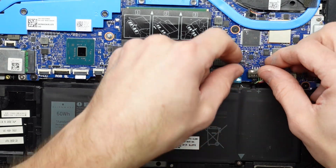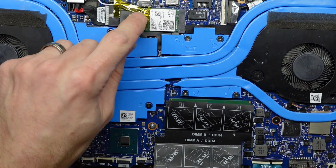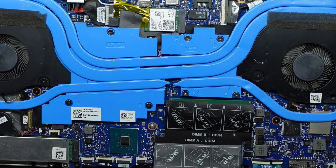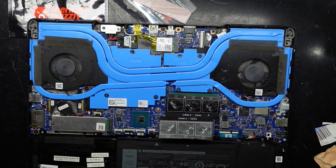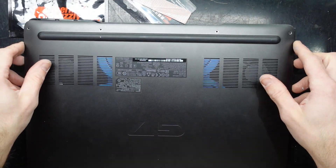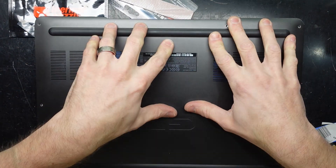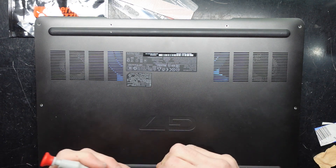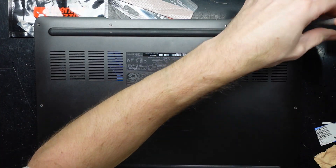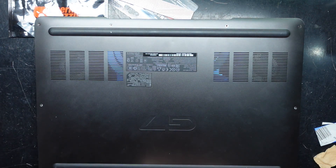I just need to connect the battery back up — it should be a matter of pushing it down over the top. The Wi-Fi antenna still feels like it's on. Now the back cover goes back on — it rotated during it, but just push down lightly and click it together. Put all those screws back in and you should be right to power up your machine. If you've upgraded the NVMe, reinstall Windows or clone it from your old one. For RAM, you should just need to put it in and go. For the Wi-Fi card, you may need to download the wireless drivers. Hope that helps — see you later, bye!